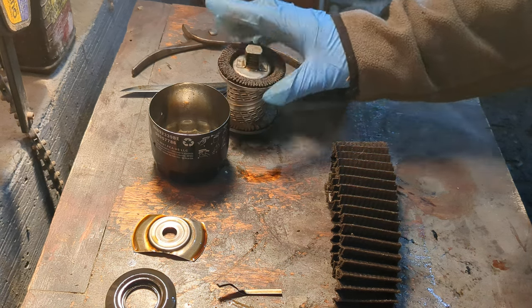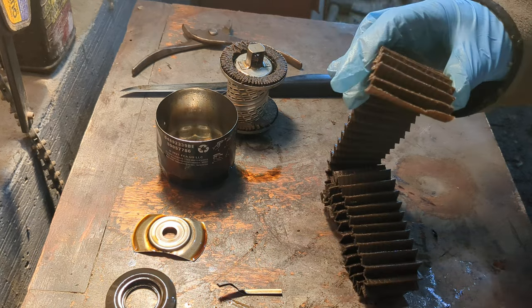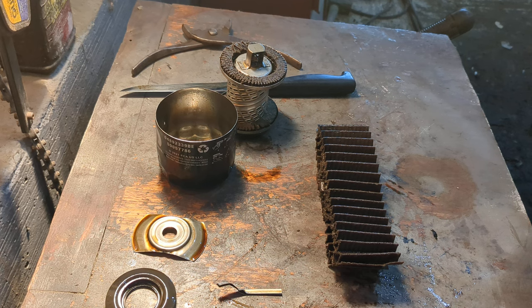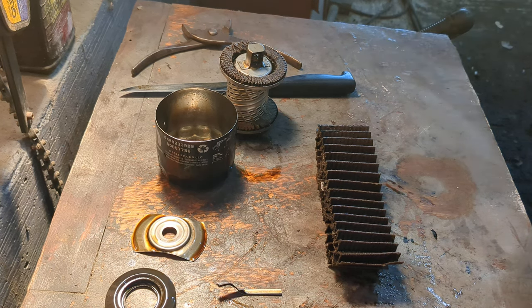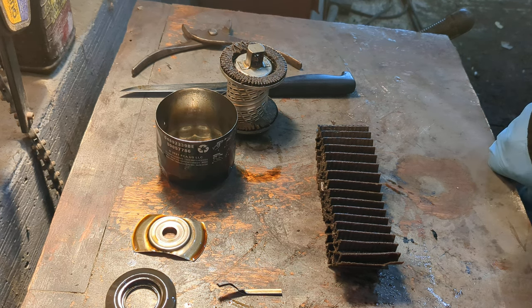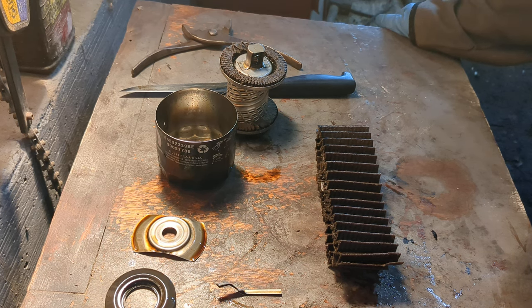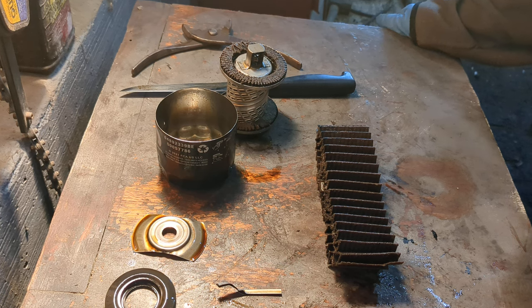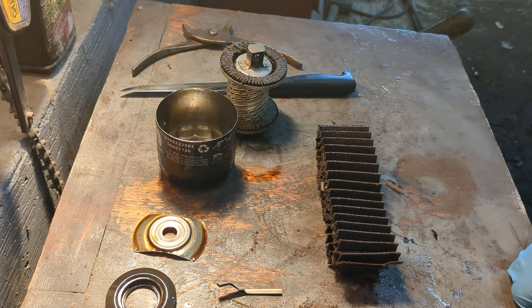I will have a new Mopar filter coming so I can review it properly and see what the filtration paper looks like before it gets soaked with oil. I still have carbon in the engine — just going to keep driving it, change the oil every 5,000 kilometers, and hopefully it'll get better over time. I'm using Pennzoil full synthetic 5W-20, which should be cleaning the engine out. If not, I may have to do something more drastic. Hope you enjoyed this — disappointing results again, but hopefully it can only get better from here. Thanks for watching.